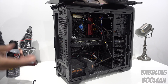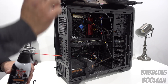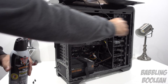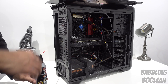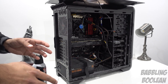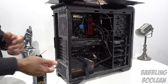Now you're going to take your air in a can, or reverse vacuum, whatever it may be, and just blow the dust out. Try to keep small children and infants away. Do not use a regular vacuum. If you're blowing the dust out and you want to capture the dust as it's flying out — don't do that. Or if you simply want to take the vacuum straight in there and suck out the dust directly — do not do that. The reason you don't want to use a vacuum in any circumstance is because you don't want to accidentally touch anything, which could cause a static charge.